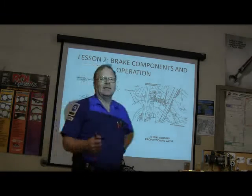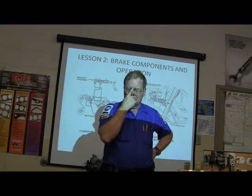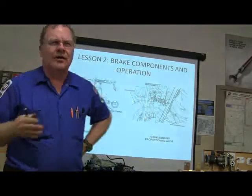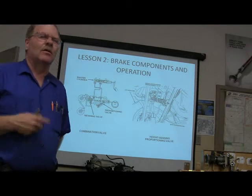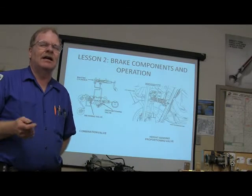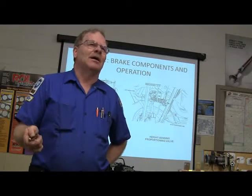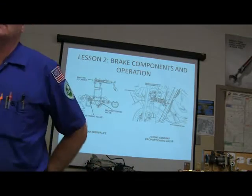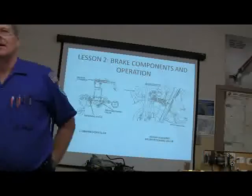And let me tell you about this one. We had this 2002 Chrysler Sebring, and it comes in, the disc brakes in the rear are rusty. I mean, they're just plumb rusty. What does that mean? If the disc is rusty, it hasn't been used. There hasn't been any brake application in the rear. Now, she wasn't really noticing anything except saying, why is my rear brake rusty? Well, it turned out that this valve was bad, and it wasn't letting any pressure go back there. I don't think I've seen but one or two of those in my whole career. They don't usually go bad.